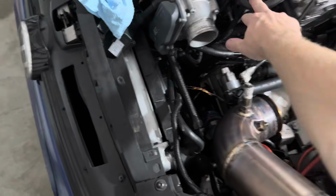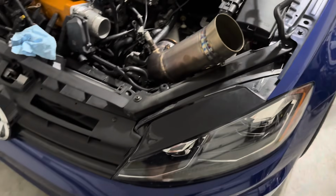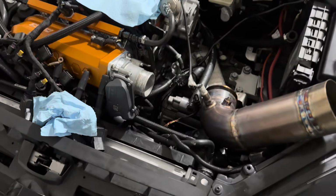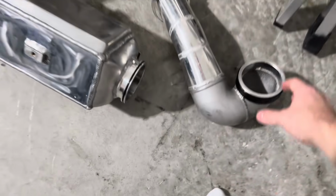So this is probably only getting a certain amount of fuel, because I run the PI-DI split on 50%, because that's pretty much what you have to do at this level. Just some small changes here and there just to make things a little bit easier. The pressure delta and everything on the air-to-water system is great.